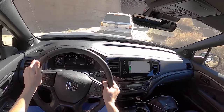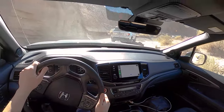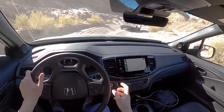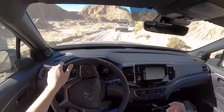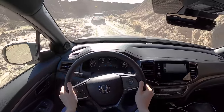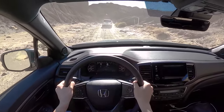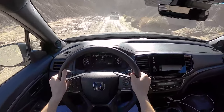I can see why the Topher has a 4Runner — you can go and do stuff like this. I did switch the car into sand mode to go over that obstacle, because I saw the way it was spinning its front wheels like crazy. In sand mode, you get more bias towards the rear wheels. It's also worth mentioning that sand mode keeps you in a lower gear — running at about 2,000 RPM right now as opposed to around 800 RPM in normal mode.